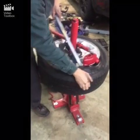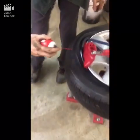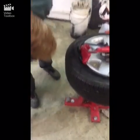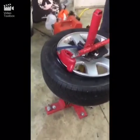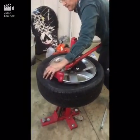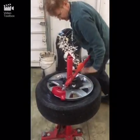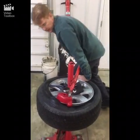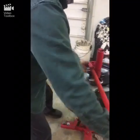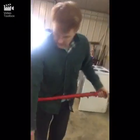There we go. I like to put a little bit of lubricant right in here. Now we've got our plastic piece, and check this out — we just move this guy like this and walk our way around the rim. We push this down a little bit into the drop center on the rim, working our way around. And bam — we're out of the rim. At the end you just rotate it a little bit to pop it out, and nothing touched.